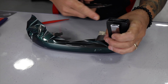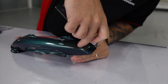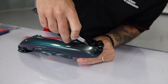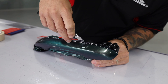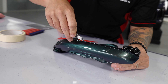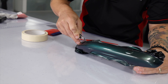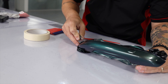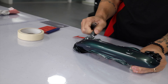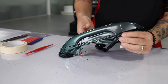This is very important to do before cutting. Also very important before cutting is to tuck the material to the edge. Click the blade so it's extra sharp, then run the tip of the blade right along the body line. The free hand must hold the door handle firmly so it doesn't shift — if done correctly, the tip of the blade will hold the gap cleanly with no chance of jumping out and damaging the handle. Work from one side towards the other in a nice, even, steady flow. Once the cut is made, release the excess film by pulling away, then come back in with the tucking tool to seal the edge.